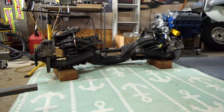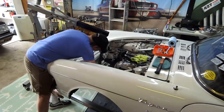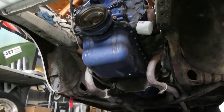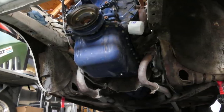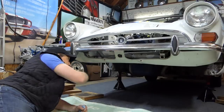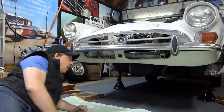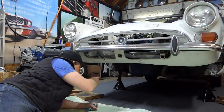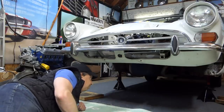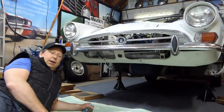I'm super happy — that's a big chunk of work. Now I can kind of drag this around a little bit. I've got a hoist that I'll put on it and lift it up and move it around safely. So now I can really easily pull the starter, pull the fuel line, loosen all the exhaust, move the downpipes out of the way, probably pull them. Motor mounts go in from the side, so you have to get a cradle underneath the motor, which I have. Then when you pull the motor mount bolts out each side — oh, and the transmission cross member. Yeah, I've got to do the top side stuff too: shift linkage out of the way, clutch fork. There's still kind of a lot of work to do. But having that subframe out really helps open it up, and it's a big step. I'm proud I got that done.